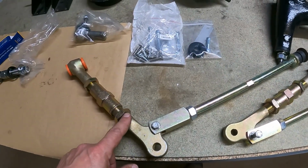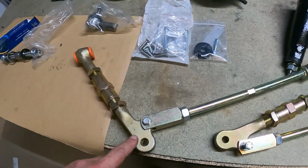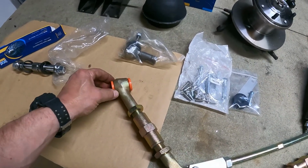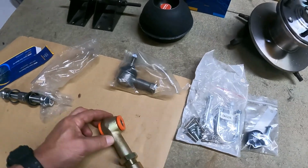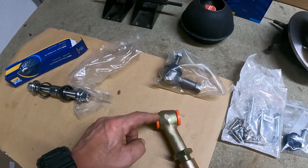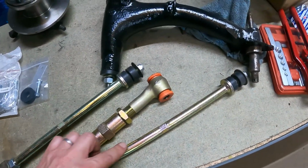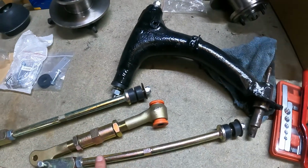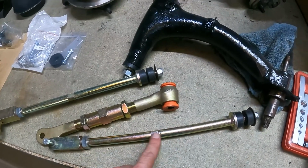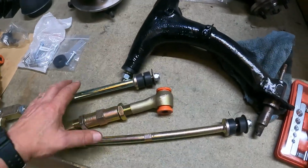Fancy pants. Control arms for the lower front suspension with all this adjustable bit on, and all of these rubbish nylon bushes in there. But I've got those black ones I showed you on the delivery which came today for these. Yeah, and there's the other bit. They seem exceedingly long and they clash into the Mini engine as well. One of them clashes on the sump and one of them clashes on the gearbox casing, so I need to do a bit of smashing with that.